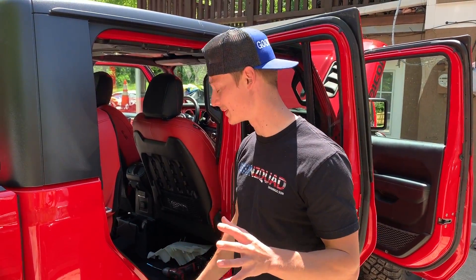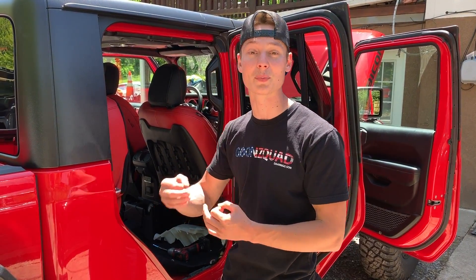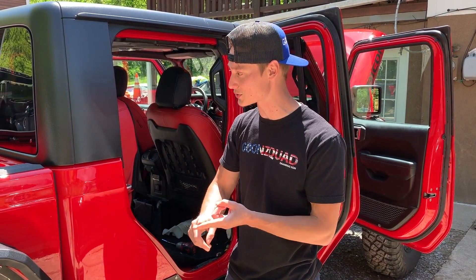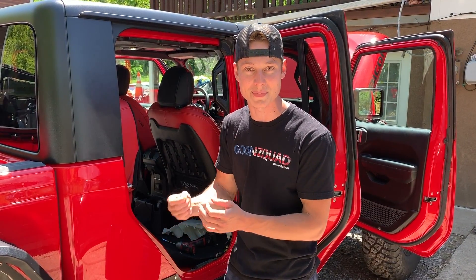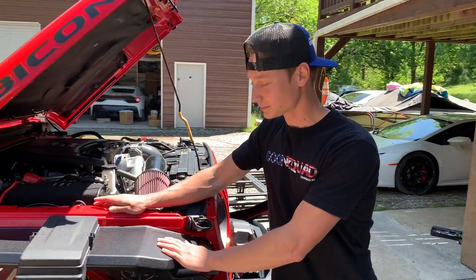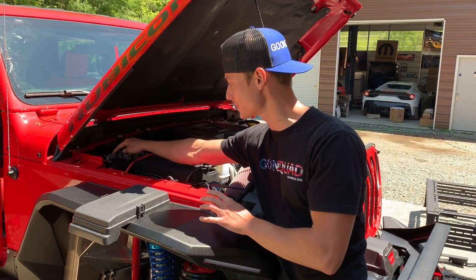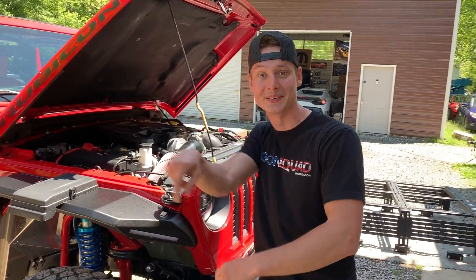We think we might have figured it out — this is a huge good sign. We made it to the plug, took it completely apart, pulled up a wiring diagram, and color-coded the wires to see where each one leads. We found the main transfer case wire, the lockers wire, and the TPMS wire — basically everything that wasn't working. We wiggled them around, pushed them back into place, and put the plug back together. The schematics also showed a relay could be bad, so we swapped the transfer case relay with a spare, and believe it or not, everything started working.